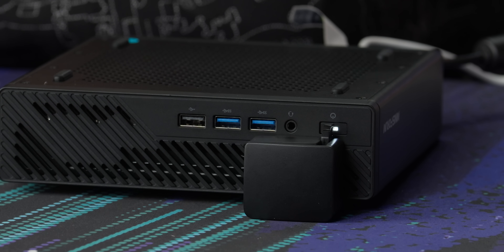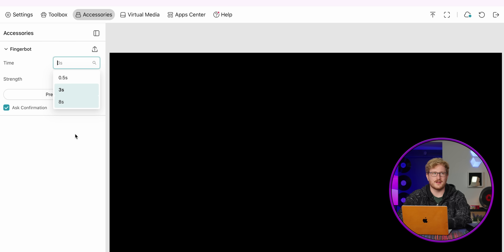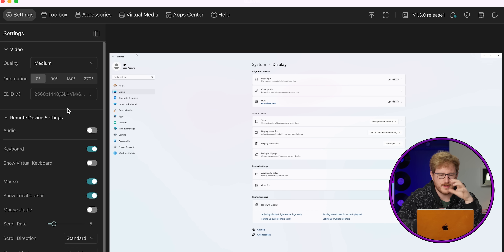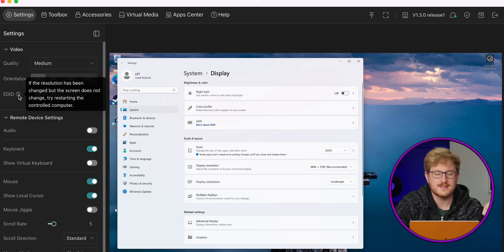You can change the press duration to eight seconds to hard shut it down if it's not responsive — hold the power button until it's fully off. We're doing 2560 by 1440. Can I change it to 4K? I tried but couldn't figure it out, then I realized there's a software update with a bunch of missing settings. After updating, now we can change it to 4K. The highest resolution at 60fps is 1440p, but for 4K we drop to 30fps. This changes the EDID — basically the information your monitor sends to your computer about resolution and refresh rate. In this case the GL.iNet Comet is acting as the monitor, telling the computer it can now do 4K. You can also create custom EDID — there are online tools for that if you need it.